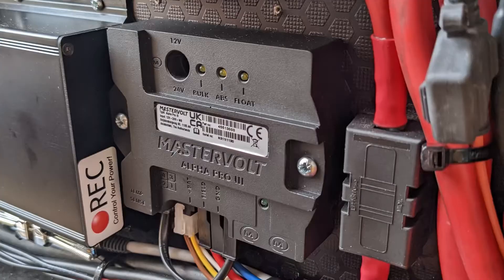I'm going to go over a job I'm doing today — installing an alternator. It's slightly different to the jobs I normally do because it's on a Vetus engine which runs V-belts, so we're using an alternator controller to get the very most out of that setup.